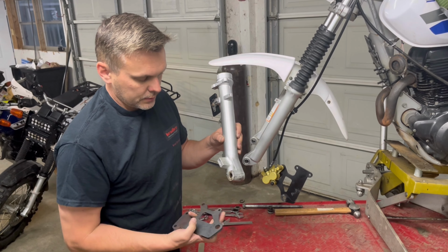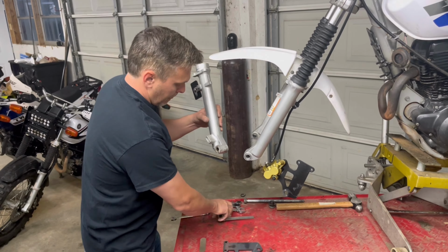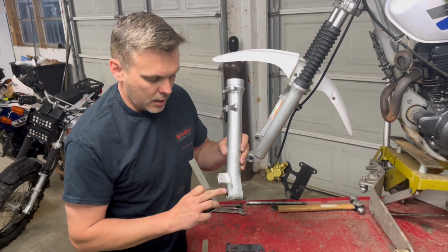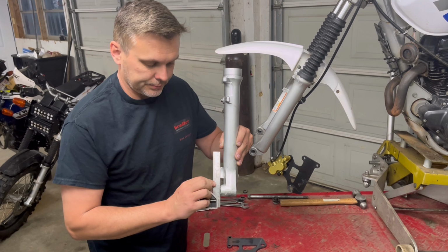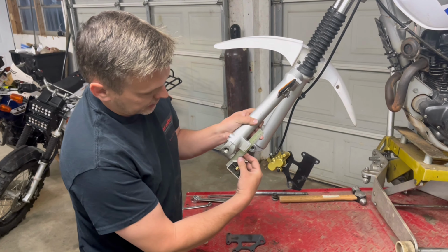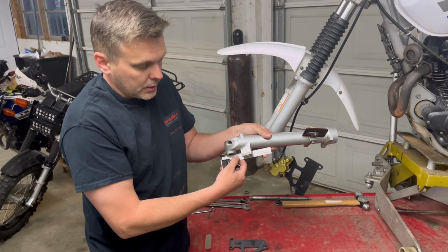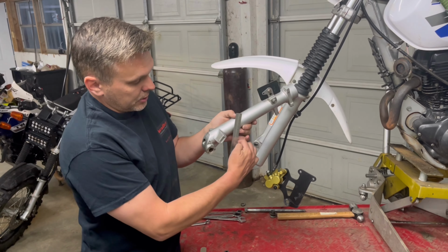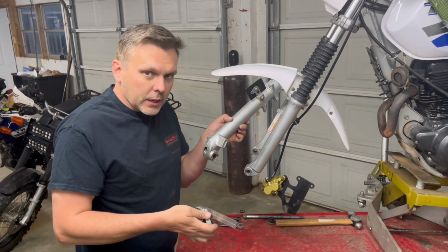So in other words, when you put a straight edge up against the stock inner face here, that much has to be removed. So it's the majority of it. You're cutting off about 3/4 of an inch of this lug. The deal is, could you just go further? Yes, you can. You can just cut it off smooth all the way down to the body. Cut the whole thing off if you want.